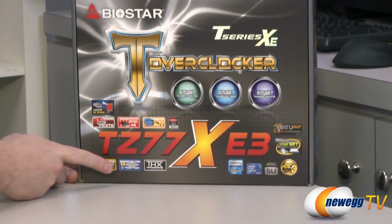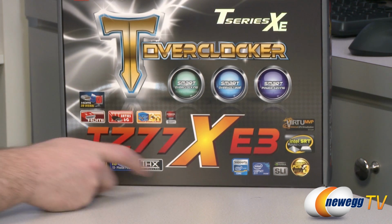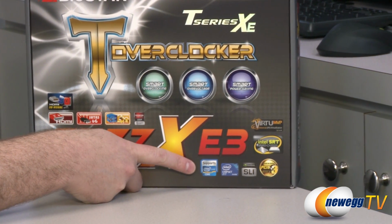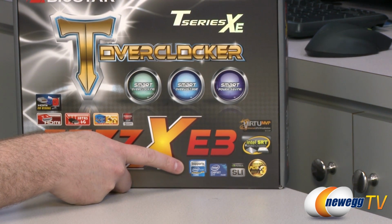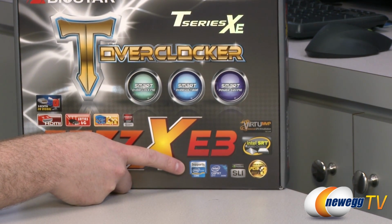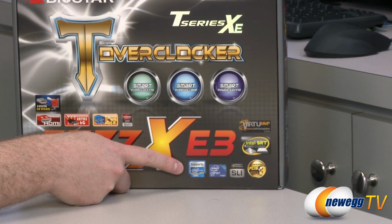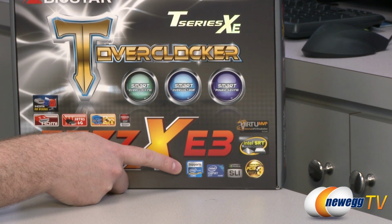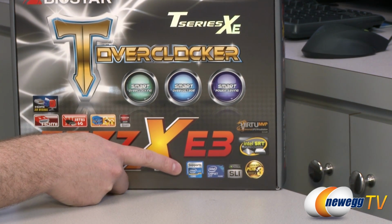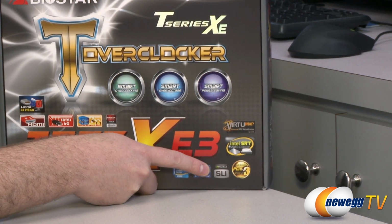You get solid capacitors, you get 13-phase power delivery, THX True Studio Pro sound. Of course, this will support Intel Core processors, i3, i5, and i7 with the 1155 socket. That means it will be backwards compatible with second generation Core processors, aka Sandy Bridge. Also forward compatible with the new line of Ivy Bridge processors, aka third generation Intel Core i3, i5, and i7 processors. You get the Z77 chipset, you get native support for NVIDIA SLI.